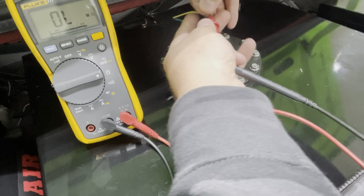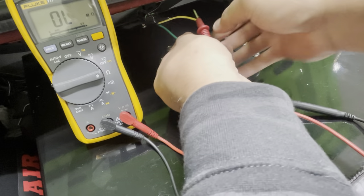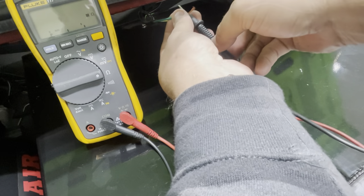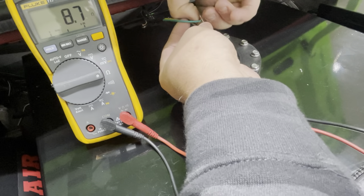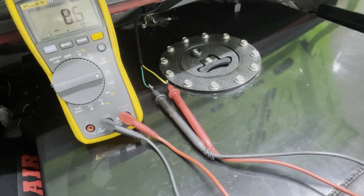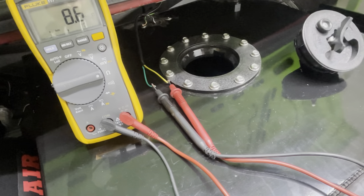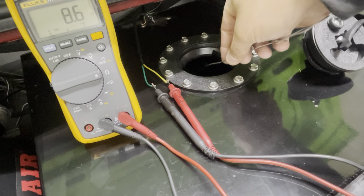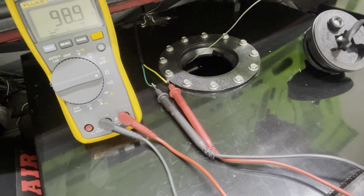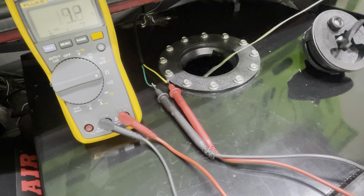One way you can check it if you don't have a data sheet is what I'm demonstrating here. Take a multimeter on the two leads of the fuel cell, set your multimeter to resistance, and then measure the travel of the fuel level sender from low to high. For my particular cell right now there's still some fuel in it so it's reading about 9 ohms. If you could fit your hand in the cell you could manually move the sender by hand. For my cell I used some mechanic wire to hook onto the sender to simulate filling it — the level sender will float to the top and your resistance changes. This is what we're going to need to program into the dash in order for it to read correctly.